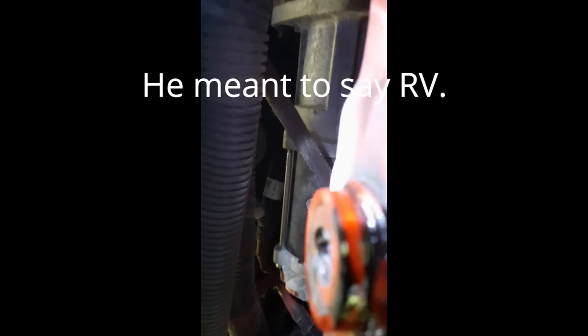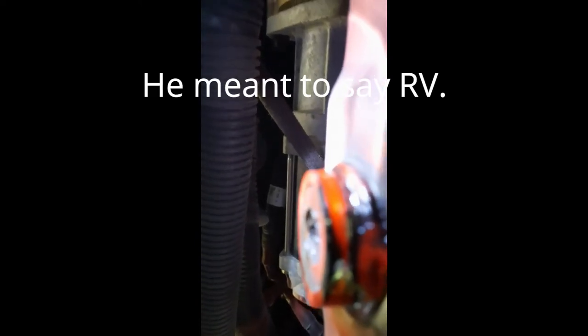Also, oil plug right there, back in. It was cleaned and tightened up as well. Also, something you don't need to reef on. I used a 3/8. The Cummins there has a fitting, and basically your 3/8 ratchet fits right in the end of it. You don't even need a wrench, you just need the ratchet.